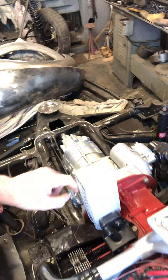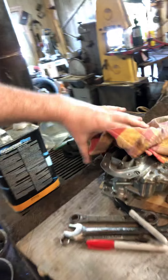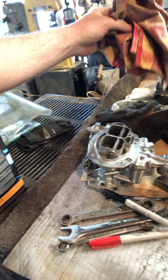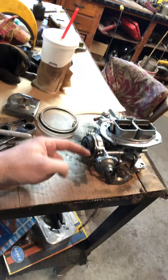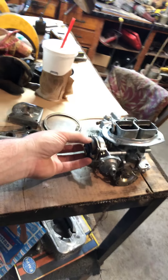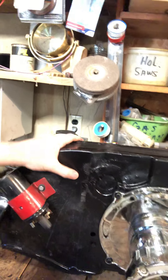You've got your oil cooler, your fan shroud goes here, and we are using a two-barrel progressive carburetor — 32/36. You can see right here we've already re-jetted it. This would be the front and this is the back, and as you can see this electric choke here on the back sticks out pretty far.